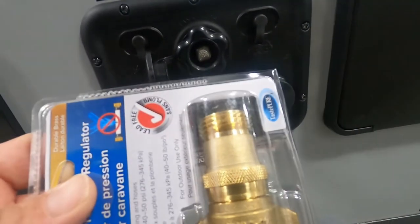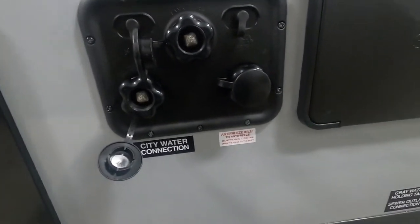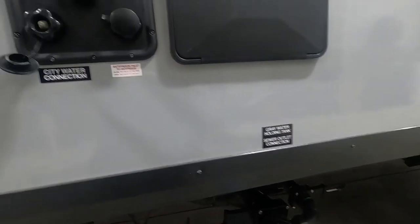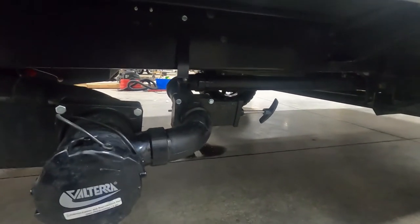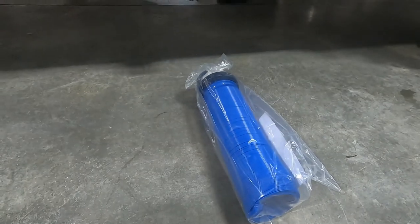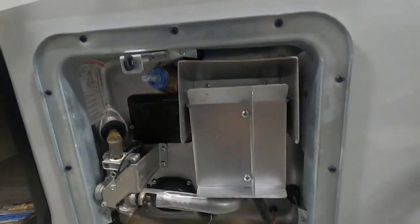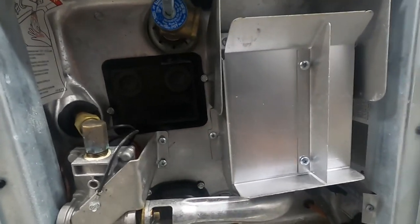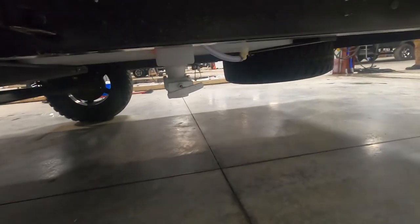Once it sounds like it's no longer draining, come up here to your tank flush. With your water pressure regulator, hook this up and hook the hose up, go ahead and turn that on, and leave your black handle open. Run it for a good five minutes — that's going to wash all the nastiness out of your black tank. Then unhook that, close your black handle, and pull your gray handle. That's going to be your cleaner water from your sinks and showers, just to clean your sewage hose out. Then go to your hot water heater — you can do this while draining — open up this valve and it's going to release all your hot water. Once that's done, remove your drain here. If you're using potable water, come here and pull that fresh water drain.